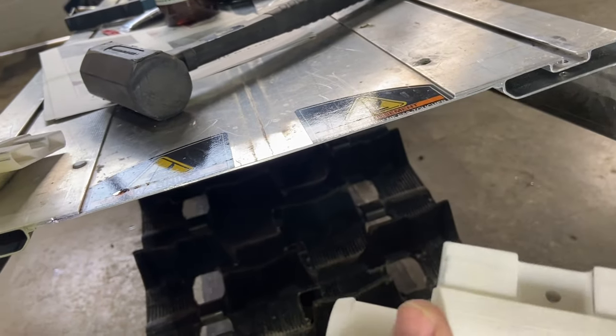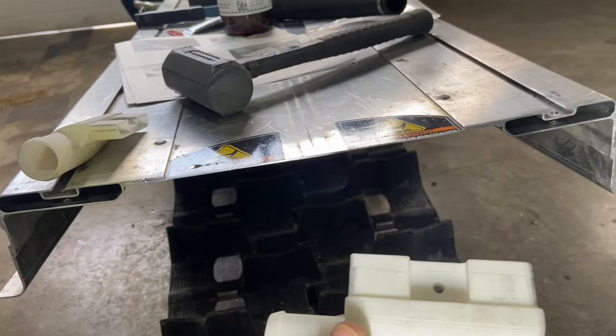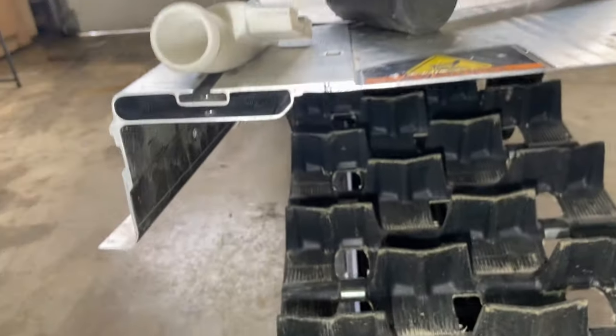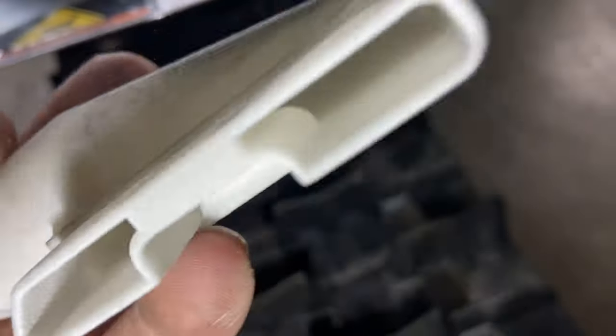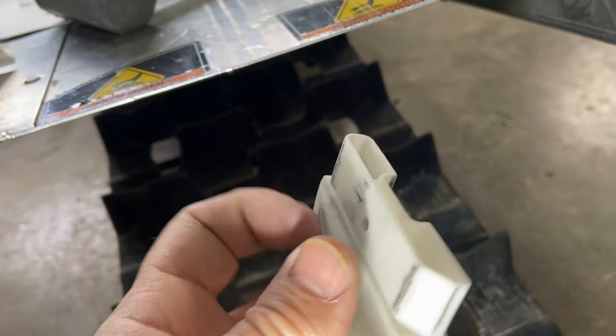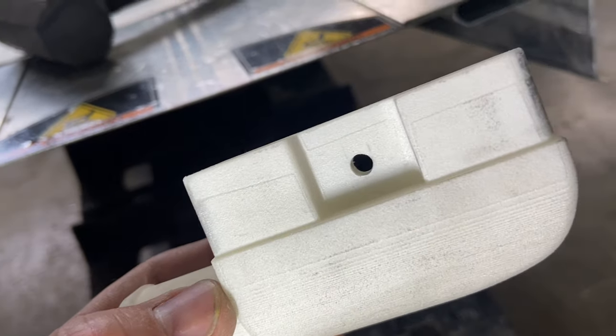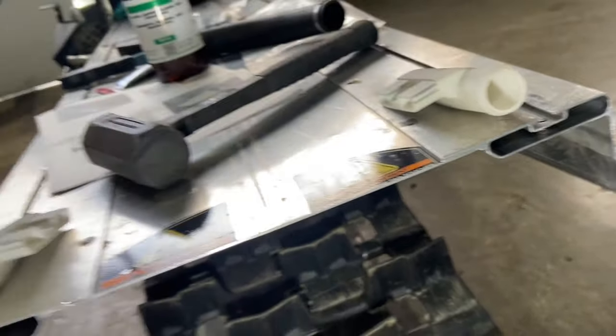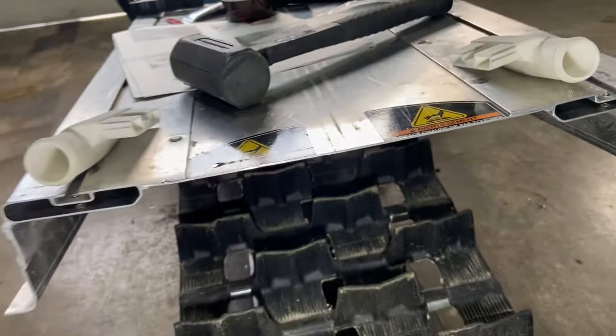So that's good to go. Next step is gonna be grab a few more Q-tips, use the rubbing alcohol once again, clean each side another time, clean each of these along all the edges that it gets inserted. I'm not worried about where it bumped it with the hammer and stuff like that. That doesn't bother us, but this, we wanna clean with rubbing alcohol again, make sure it is perfectly prepared there. And then double, triple check in here, and then it'll be time to start mixing up some epoxy.